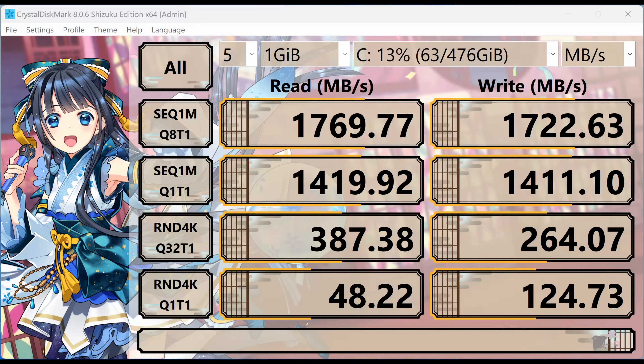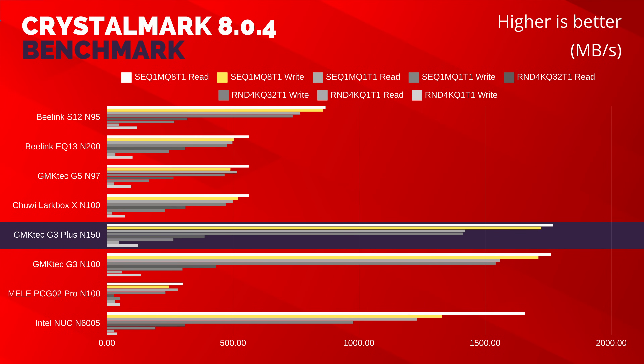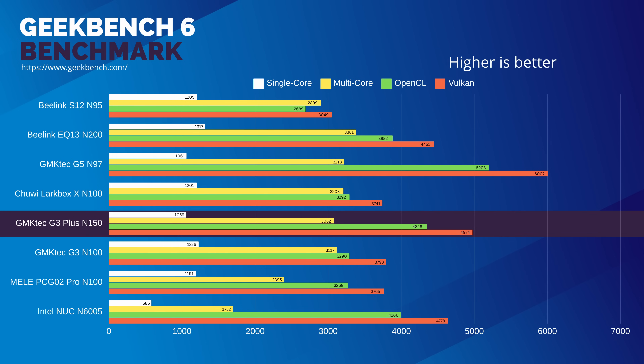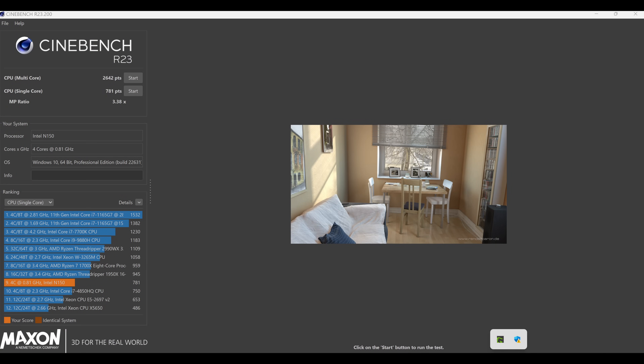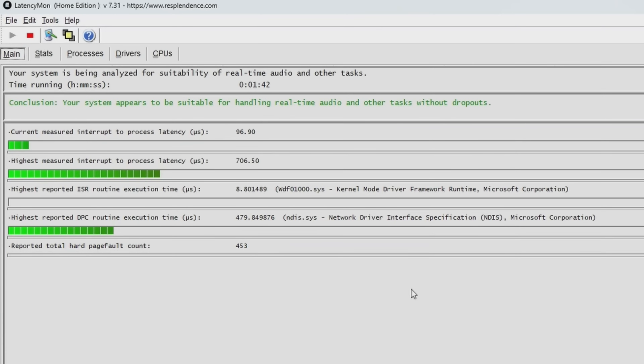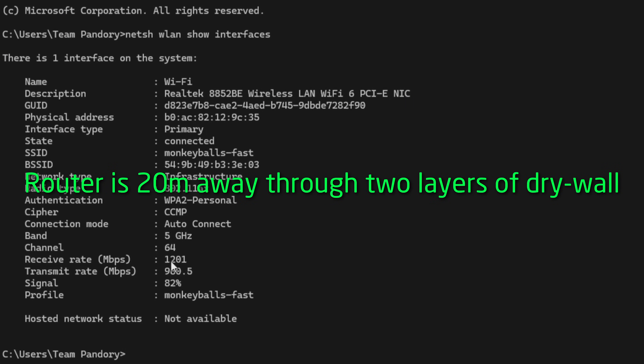So let's move on to the benchmarks. Shizuku gives us a fairly decent score for a PCIe 3 drive, but if we put it up against the original G3, it's saddening to see there's a slight downgrade, but faster than the competition at this price range. There's a slight dip from the N100 CPU scores, an improvement from the GPU, but this gets completely floored by the N97 in the G5. We get similar information from the TimeSpy benchmarks, and here's Cinebench. Latencymon states we should be good for real-time audio, but as the CPU only has 4 cores, this won't be able to handle more than a few VSTs. And for a Wi-Fi and Bluetooth test, we're happy to report a good connection with no dropouts.